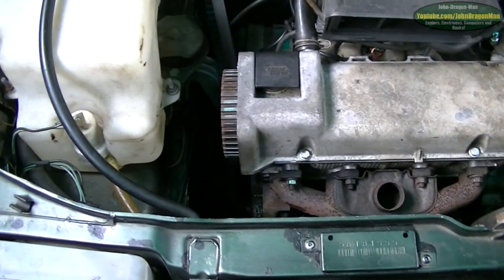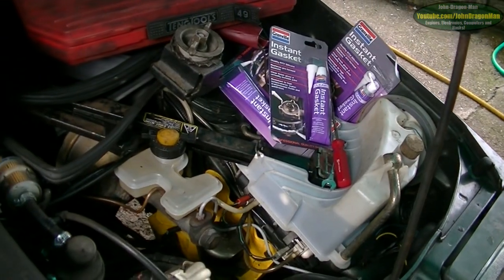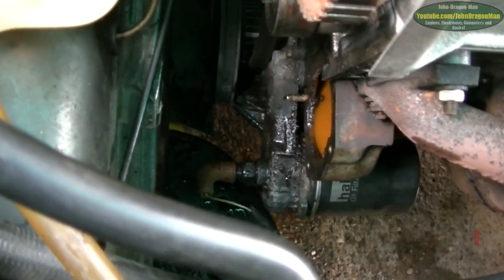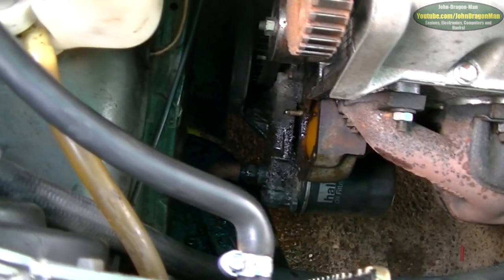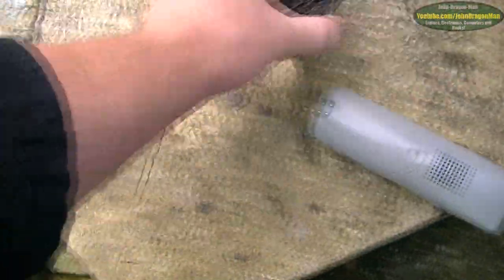The next job is to drain the coolant — I need a bowl, undo the little hose clamp here, and let it all spin out into the bowl. Sorry about that — there's been a two-day delay because I hadn't got any gasket sealant at all, so I had to order some online. One auctioning website saved my life yet again. I completely forgot to film while doing it, so I've already taken the cam belt off and the water pump out. There was no gasket as such — it was just full of silicone seal. We compare all three together and they're all the same sort of pump.